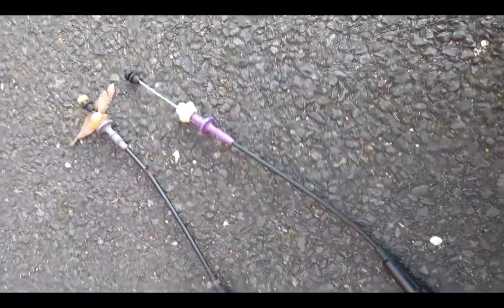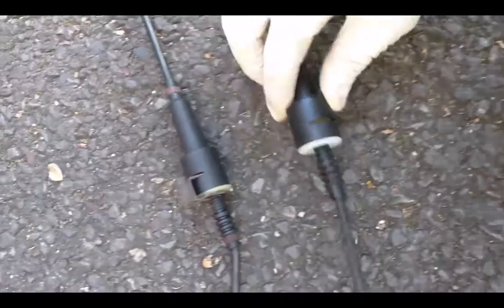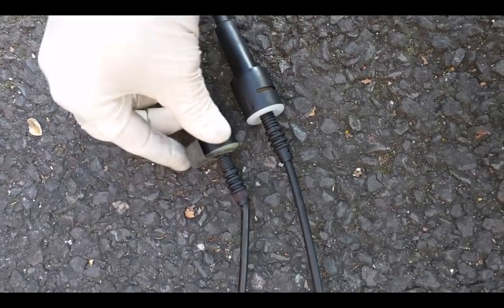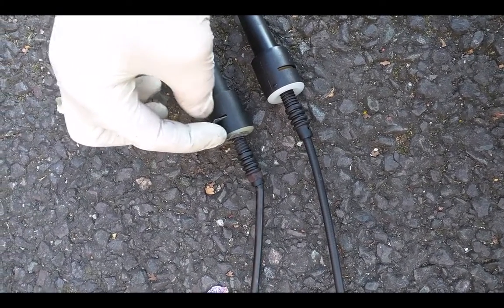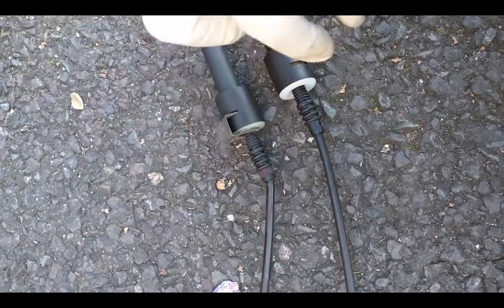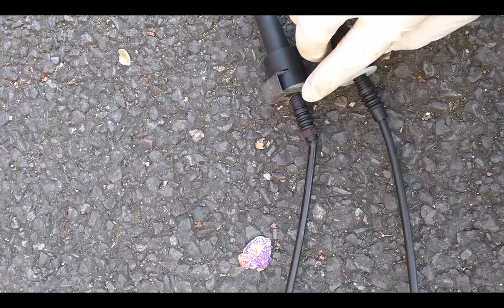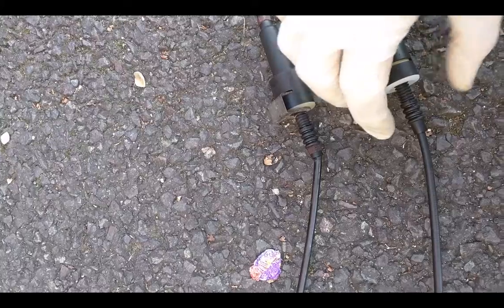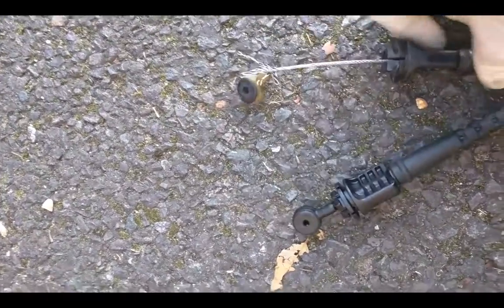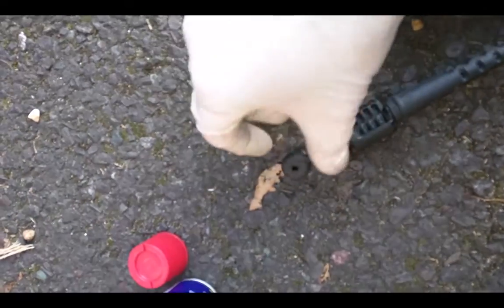I have the new cable here which comes from Ford. When you want to put in the new cable, check this fix metal here — you can pull this out and plug it on the new one. Check how many marks you have here and put it on the same position on the new one so it keeps in the right place. The other end looks a bit different but should go on the same hook.